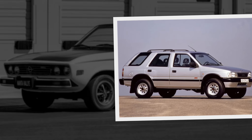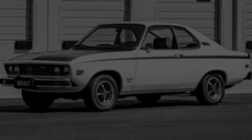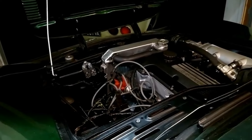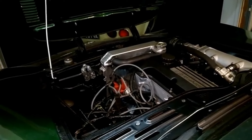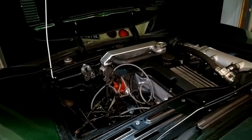The great thing is these systems were some of the simplest Bosch multi-port injection systems out there and very flexible in their design. In this motor I use parts from a 2000 Ford Mustang, a 2000 VW Golf, a 1994 Saab 9000, and three different generations of Opels. And that's where the flexible nature of these multi-port injection systems really comes into play.